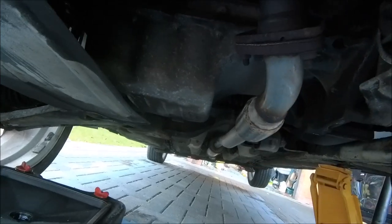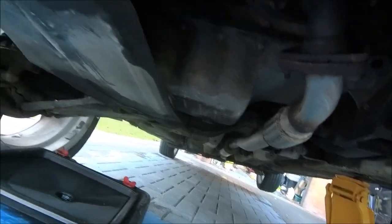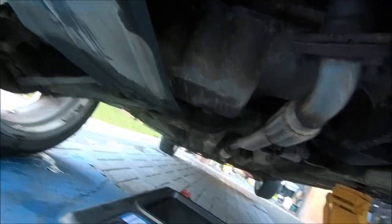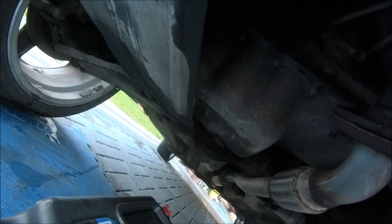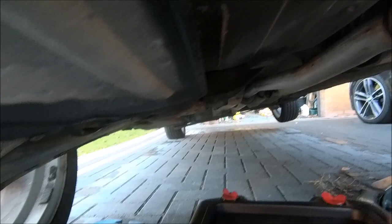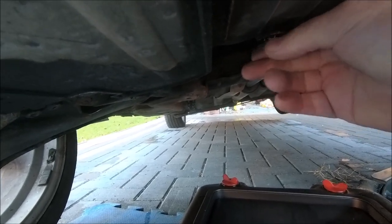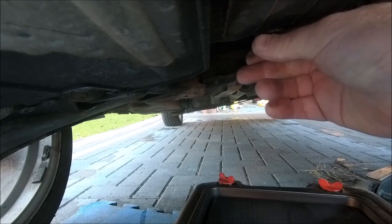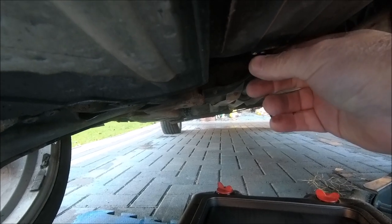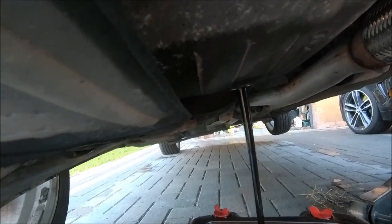It's nice under here, and the exhaust as well — bonus, didn't realise it had that on it. Right, got my oil pan in place down there. I've got my T40 ready to undo the bolt on the sump. Let's get this old oil out. She's loose — let's get some oil down my arm. Ready? Yeah, lovely. Right, up top now.